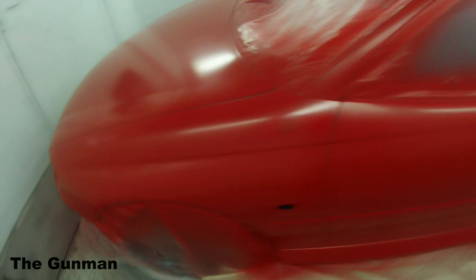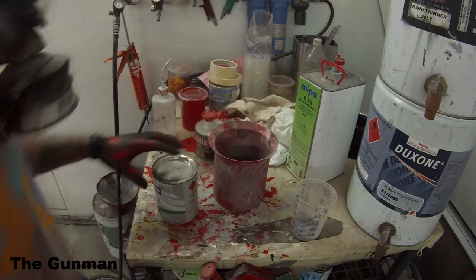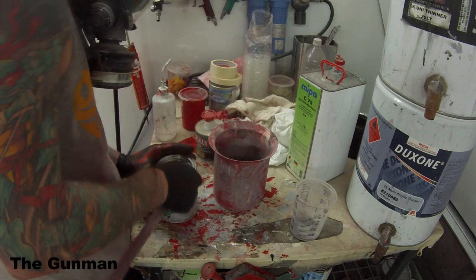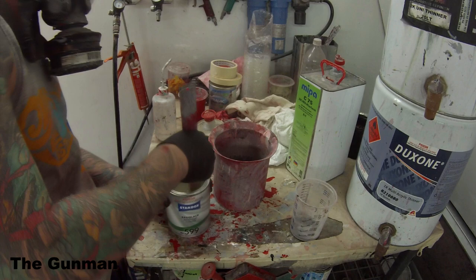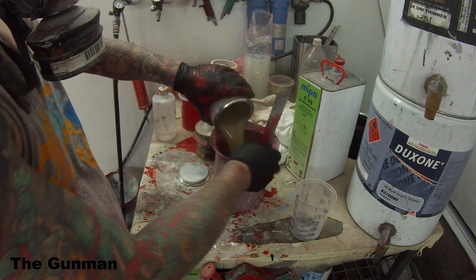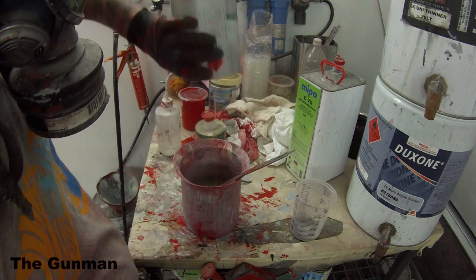That's after the base coat stage — I put a good three coats of the Sting Red down. F143 is the paint code for this car. I actually really like this color just by itself. If I were to put clear over that, it's still a nice bright clean red. Here you see me getting into the 599, which is what I was referring to earlier as the blending clear. The main reason I call it that is because I used to use the Glaserit system and they refer to the exact same product as blending clear. I'm just going to tip a lot of that into the can, add a bit of reducer to get the last bits, and next up I'm getting into my pearl.